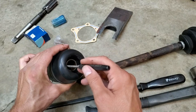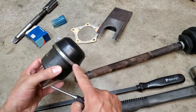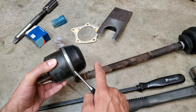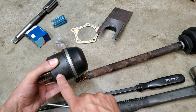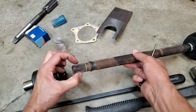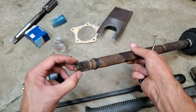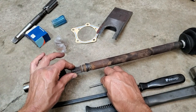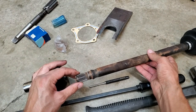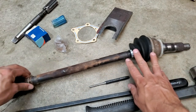You can just get the punch on the ring here and tap evenly across until the joint releases. Sometimes you can try spraying a little penetrating oil in here to get it to release, but typically it's just tap tap tap and away it comes. If it doesn't want to come apart, your only other option is to remove this band — the factory band is a continuous piece that's just pressed in place; you have to cut it with snips or a Dremel. Then you can pull the whole assembly out of the inner joint. Once done, the boot will be hanging on one end and you can use a hammer with the assembly supported in a vice to knock the axle out of the joint. If you only need to fix an inner boot, that is what you'd do.